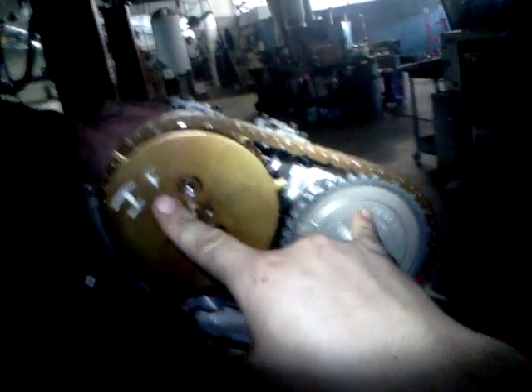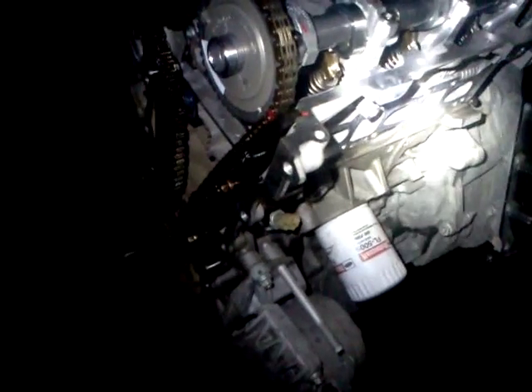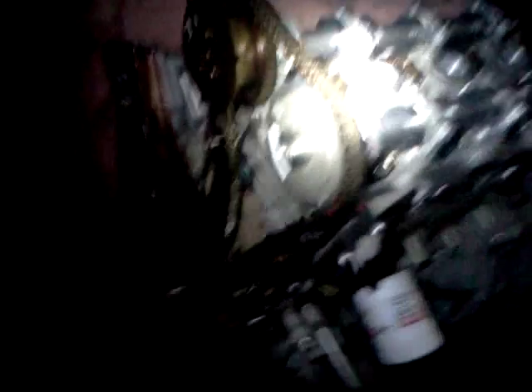So that's Ford's variable cam timing. The remark I had was on the new 5.0 Mustangs with the twin independent variable cam timing — that's when both of these cam gears have cam phasers on them. So for each side there's one phaser, two phaser — you can see this is the EV6 — and they didn't want to mess up oil pressure for that particular reason. That's why I decided to do this video.